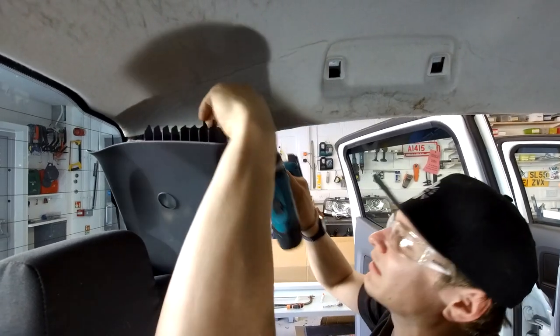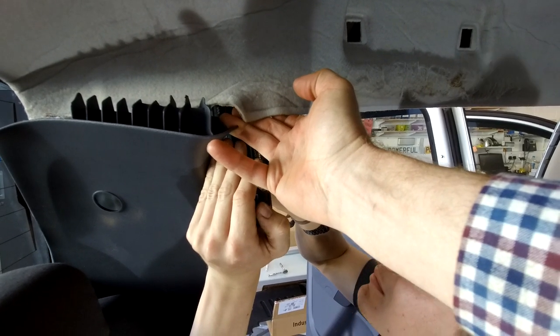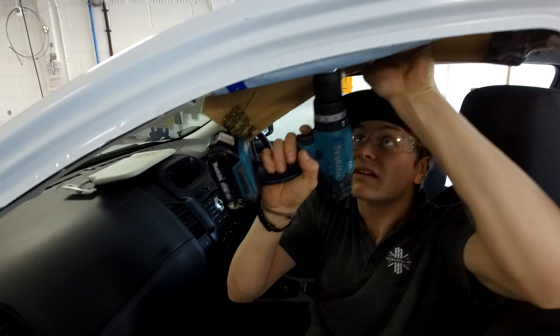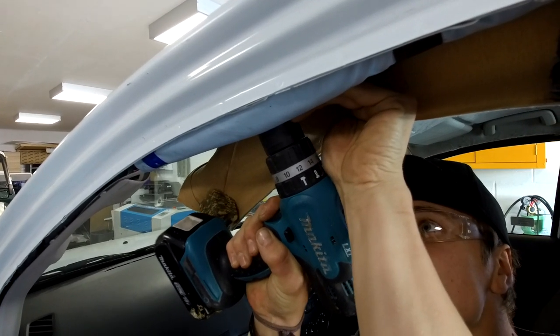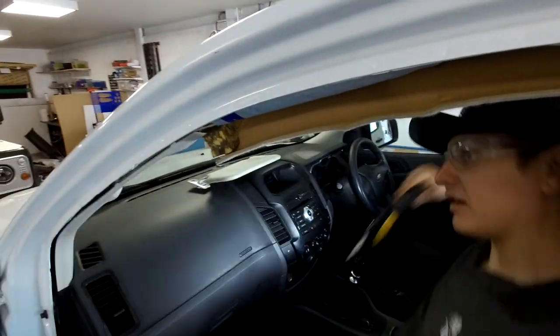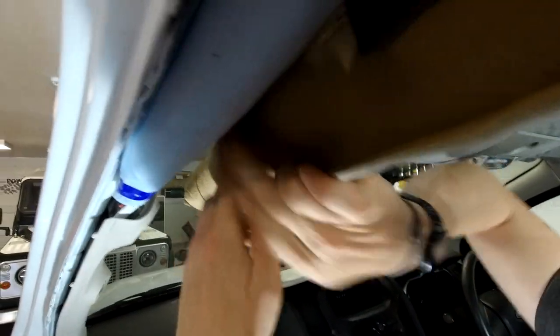Ian's drilling through there. Just piloted it with a 3mm drill for now. Both holes done — that was quick. Same again at the front. It doesn't matter if you drill through the rubber at the top because we're going to cut that section out anyway. The big square boss fits in the channel, so we need the holes in the right place.